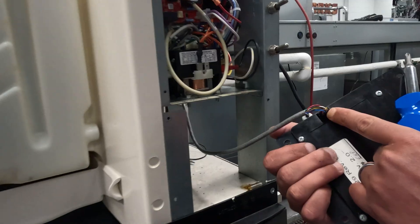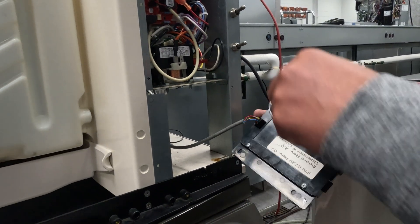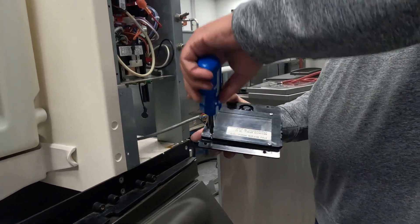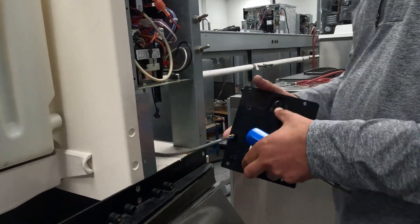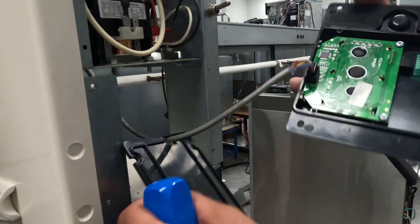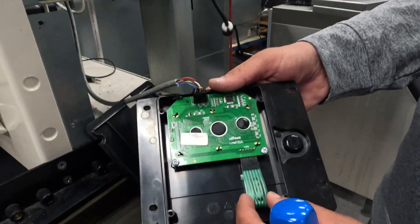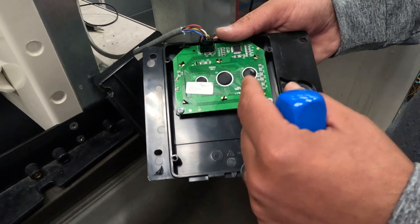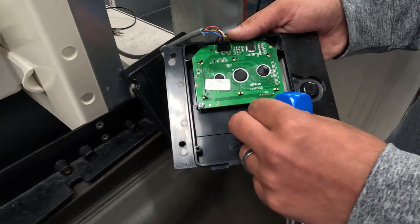You have to leave this cable plugged in to do what we're doing — we're going to use the power button here in a minute. So we're going to open up the back of this and pull it around to expose the back of the display. We've got our little ribbon cable here that's sending the signal from all of your buttons to the display, then back to the control board. So we're going to wiggle this off.